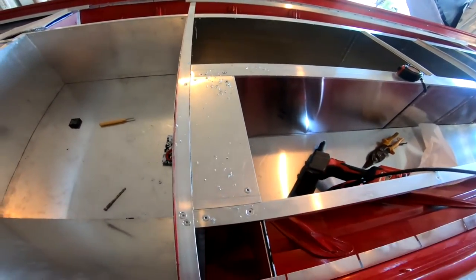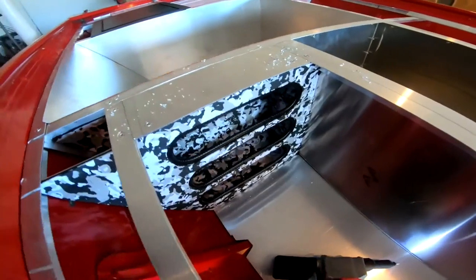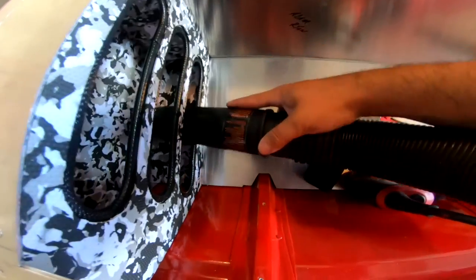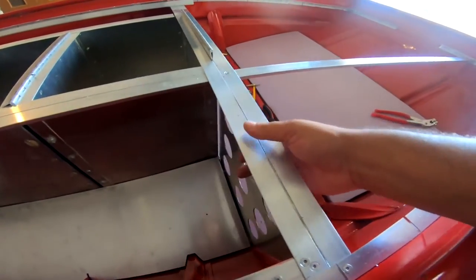Slow and a lot of pressure — those are tips you never hear in videos. If you run it fast, you can see the edge is horrible, it looks like teeth marks around the bit. But with slow and pressure, it is a nice clean perfect cut. All right, that piece is in and this back end is done. Let me vacuum out all these pieces and pull this one out to get some foam on it.